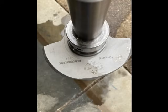All right, so we're going to focus on the rotating assembly here for a few minutes. I used an Eagle crank on this engine. It's a 4340 steel crank. I got this for like $100, and it was a new crank, so I couldn't pass that up. I don't use a lot of Eagle stuff, and I think I've only used probably two Eagle cranks and maybe one set of Eagle rods during my engine building career. And there's been some failures and some quality control stuff, so I generally lean towards Scat, but for $100 I couldn't pass this up. And we had it magged and walked all over it just to make sure there weren't any journal issues or heat treatment issues or anything like that. So that's what we went with. 3-inch stroke, as you can see there.